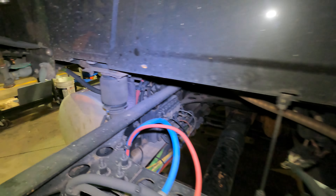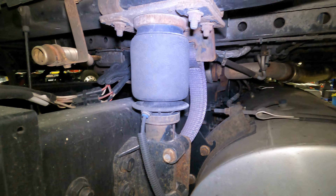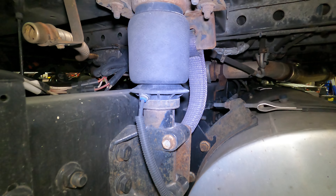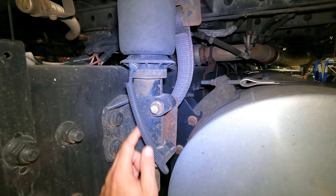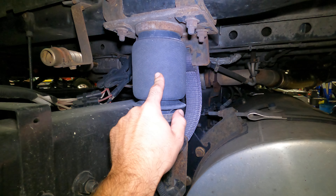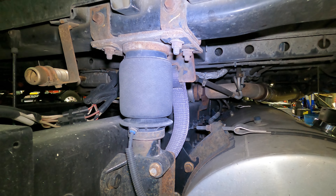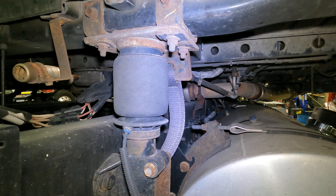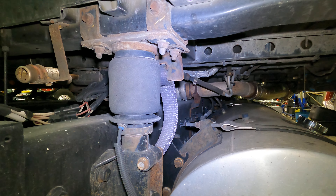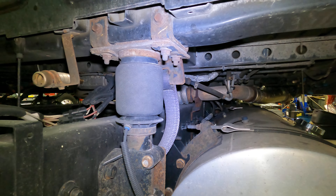The second airbag is on the driver's side over there. These airbags are a little different than the ones on the suspension because they have a shock going through them. As you can see, it attaches to the chassis with these mounts and then there's a shock going through this airbag to give it the smoothest ride possible. If these airbags go bad and there's a minor air leak, get the unit right back to our yard to get it replaced. If it's a major air leak, we'll have to get it done on the road, but we usually never have too many problems with them.